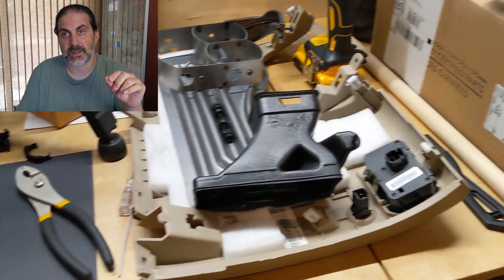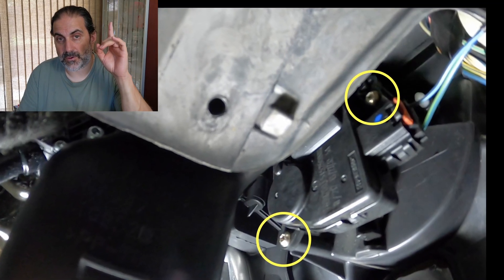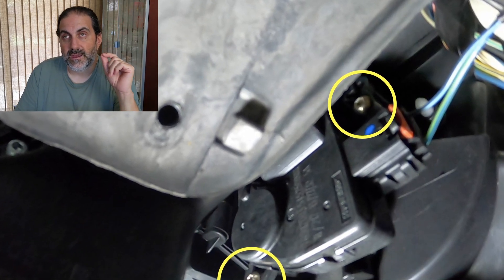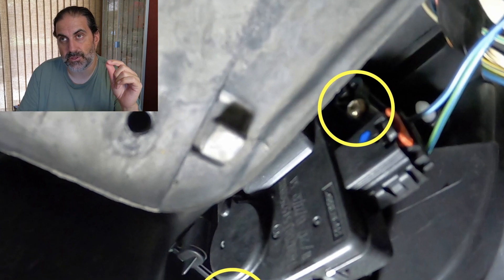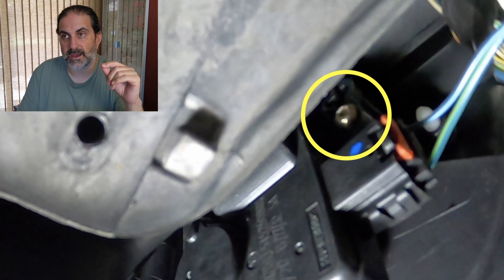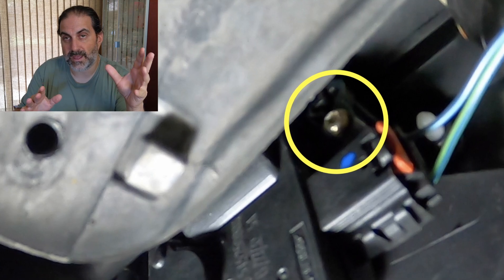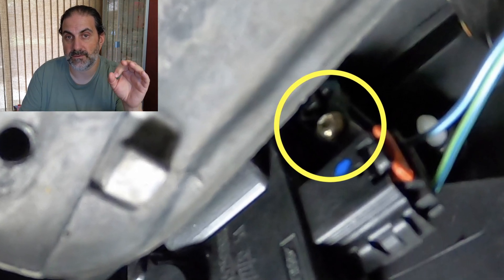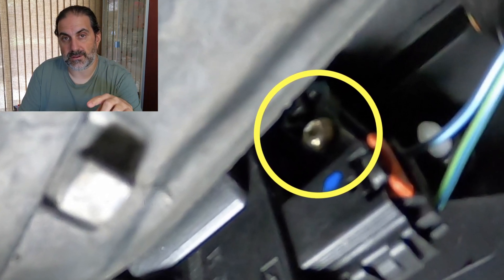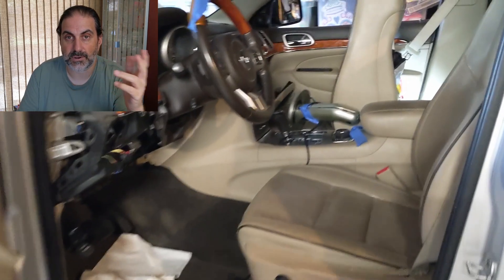You're gonna need some millimeter sockets and a T15 Torx bit. There is this one torque screw at the top of the whole assembly that's wedged in behind a bracket. For me, getting that thing out and back in was about 75% of this job. I think if I had a nice shallow T15 wrench — something with a ratchet maybe — it would have saved the day. So hopefully you'll be able to get your hands on something like that before you start this. But if not, I'll show you what works for me.